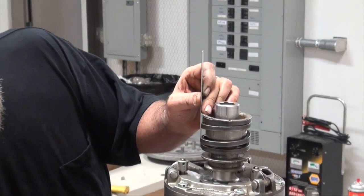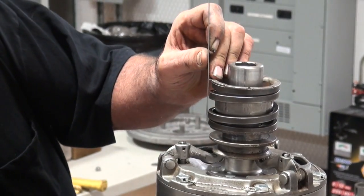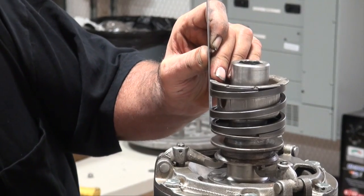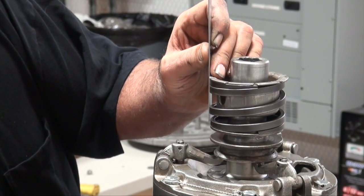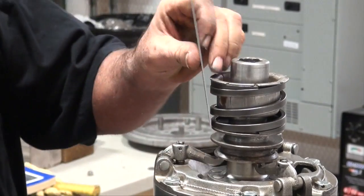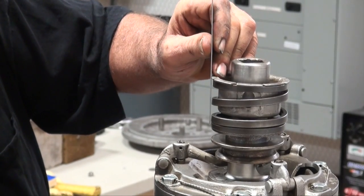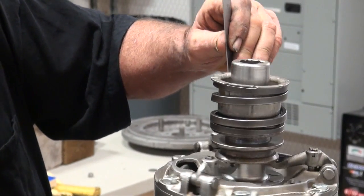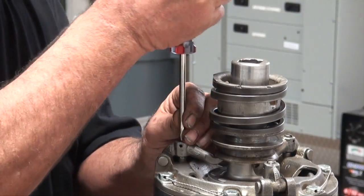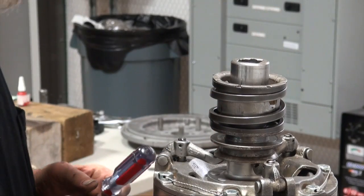Get over here on this one — it's going to be another half turn. And there's two inches. That one is just about there — two inches. Two inches. And two inches. So I'll get three cotter keys and run them in here and just bend them over slightly.